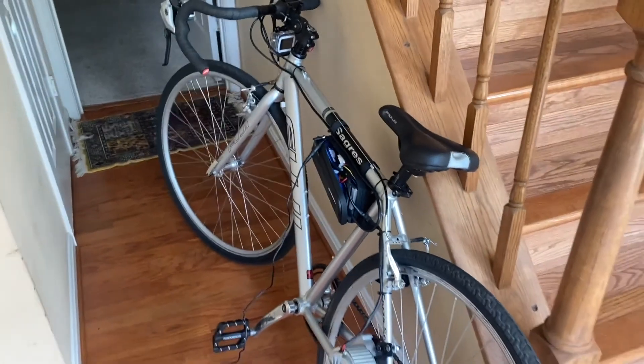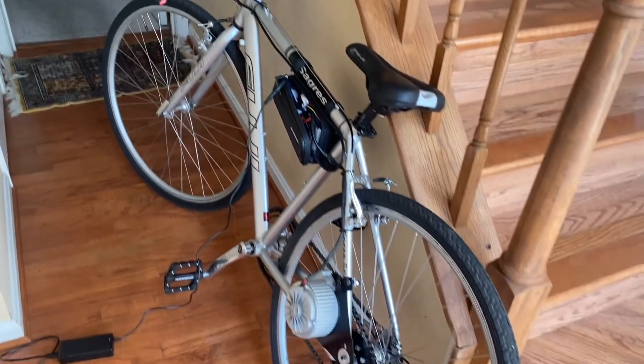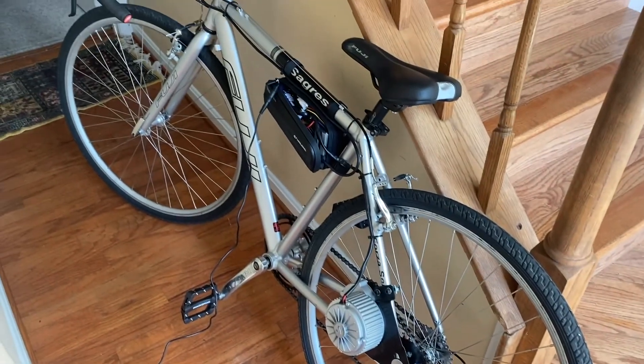It still did it on its own, so I have no doubt this thing could probably do 15 miles with no hills, or 16 miles, and obviously more with pedal assist. As far as top speed today, it actually didn't make too big of a difference whether it was flatland or downhill — it was going maybe 23 to 24 mph downhill, but on flatland I remeasured it and was able to hit 22 miles an hour. Uphill, depends on the incline, but when it was fully charged it would do about 12 to 13 mph going uphill, maybe 5 mph in the last two miles.